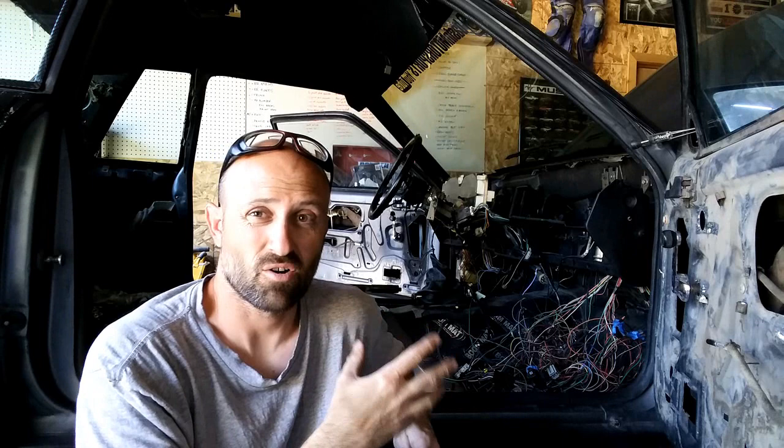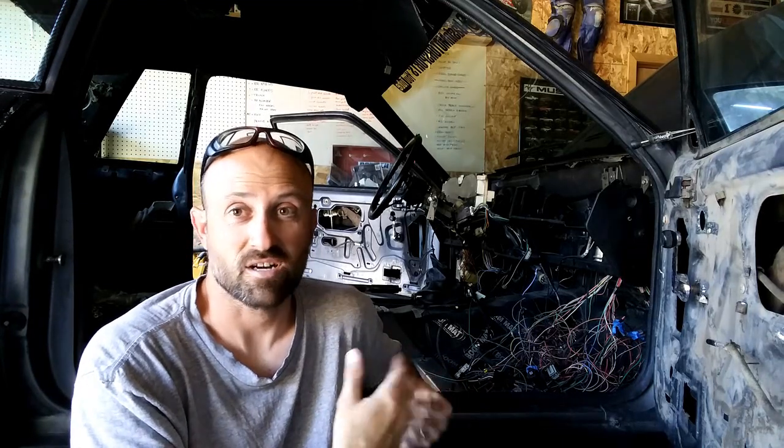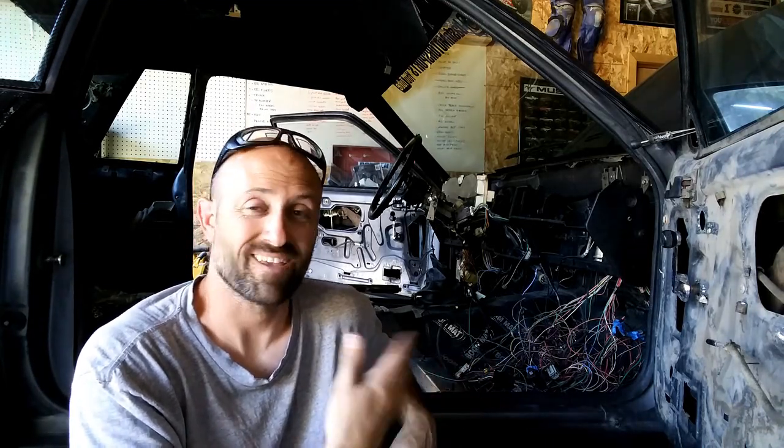Blower motor is hooked up and it doesn't turn on. So there again, I don't know. I know this original harness in the 80 is pretty chopped up. I think they had an alarm in here, and there's just too many cut wires, basically splices here and there that I need to go through. After I get the ECM to fire up, I'm going to go through each circuit and look for things that are wrong, things that are right, and then try to slim down that harness if I can. But let's check the scoreboard at the end of today.